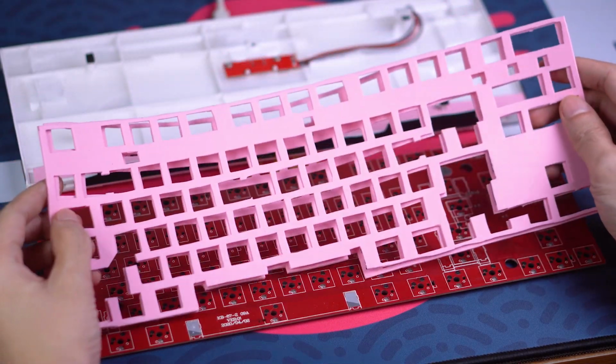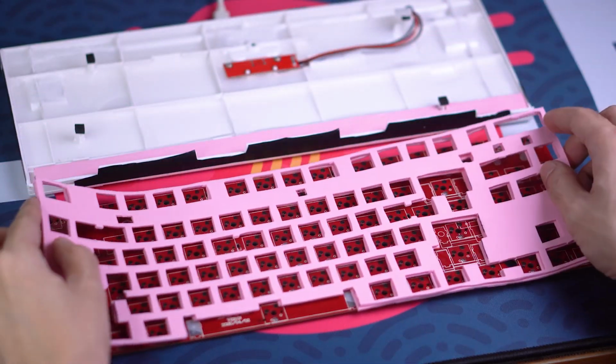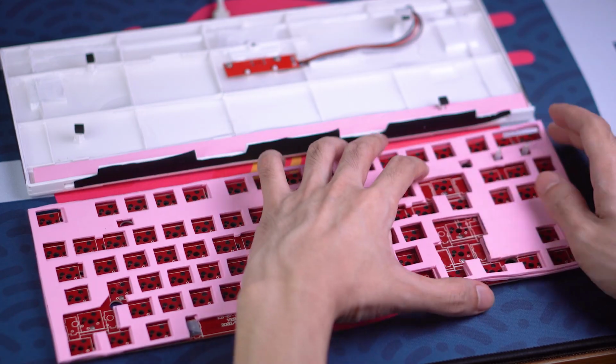I also did a couple more mods along with the silicone. First, I swapped out the spacebar stabilizers for the ones from my Gamakay LK67 because they were rattling. And second, I added 2 sheets of 2mm EVA plate foam that I had already previously cut.